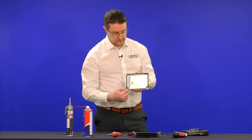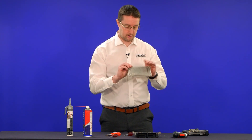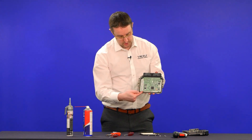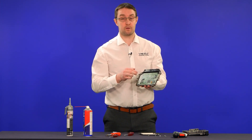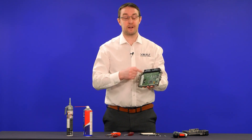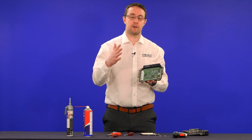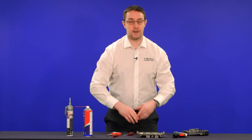I just want to show you inside here — on the back of the lid you can see this black bead of silicone from the factory. That's the seal on this raised edge that we're trying to get our screwdrivers in and separate away from the ECU circuit board. On this ECU example you can see the black silicone edge and where the heat sinks were. You can put more thermal paste on there when resealing if you like — it's tuner's preference. I do recommend clearing off any excess that was there first. In all the years we've been doing this, we've never had to reapply heat sink material — as long as you keep it clean when resealing, there's enough thermal transfer that it doesn't overheat anything.